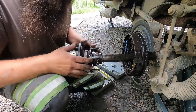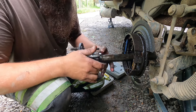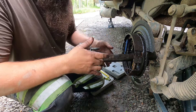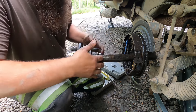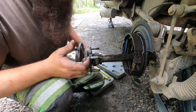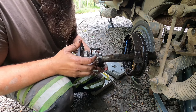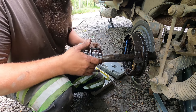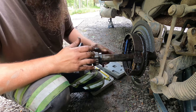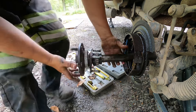When you put all this back together, you've got to make sure you put the seal retainer plate on, put your seal on, drive your bearing on, and then heat this retainer up. You heat it to expand it bigger than the diameter and it goes on nice and easy. Then you wait for it to cool and it's tight. Whenever you buy the rear bearing, it comes with a kit: the retainer, the bearing, the race to put in here, and a new seal. This race doesn't look too bad but we'll change all that. It's a pretty easy disassembly — now it's the fun part.